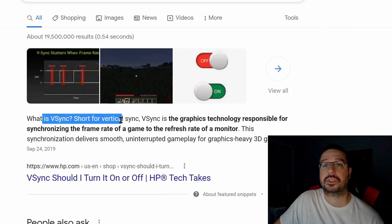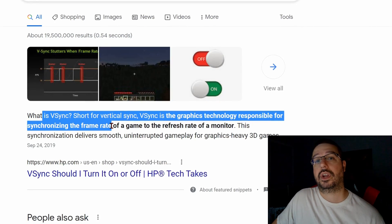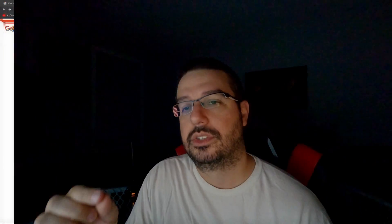That's your GPU's frame rate going too quickly for the display to handle and getting out of sync — so you have a tear. They came up with Vertical Sync, otherwise known as V-Sync. V-Sync is the graphics technology responsible for syncing the frame rate of a game to the refresh rate of a monitor. The GPU will say we're pushing 125 frames per second, that's way too fast for the TV to handle, it's going to create tearing. So the GPU will limit or throttle back the frame rate to 60 hertz to match the display rate so you have no tearing — GPU at 60 frames per second, the TV at 60 hertz, a one-to-one ratio, no tearing. The problem is with Vertical Sync it has to throttle back the GPU's throughput or frame rate.